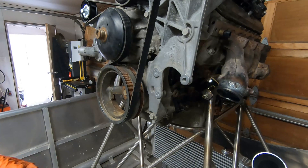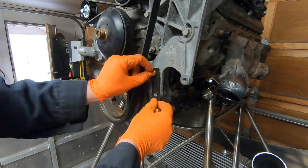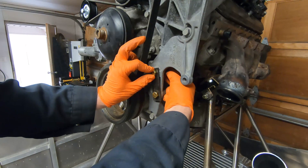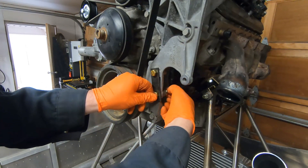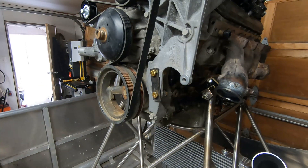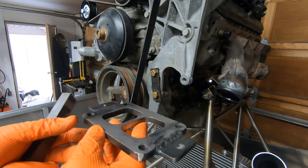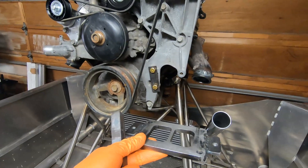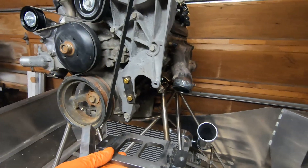It's not really a whole lot of time to try different spots — fabricating new brackets doesn't take long. So I'm going to try another spot using these accessory holes. I'm using a piece of flat stock steel; I thought about using stainless but for now I'll just use mild steel since this wall will get painted anyway. The plan is to mount the flange around here, which will line up the compressor with the intercooler quite a bit better.